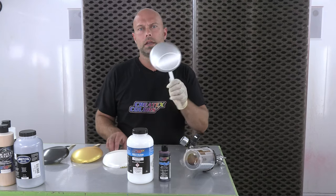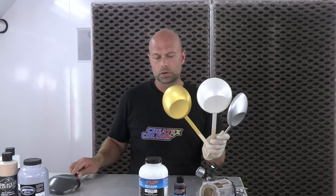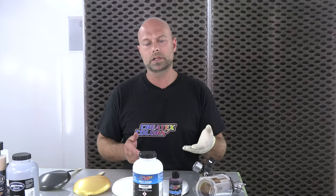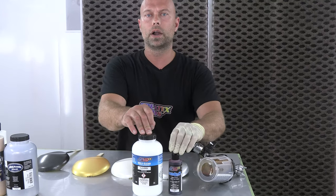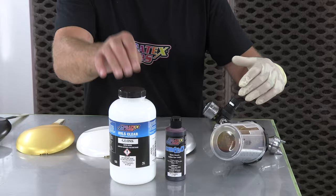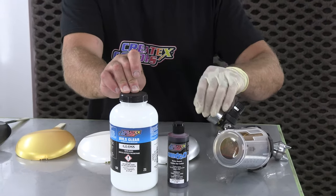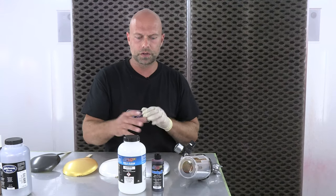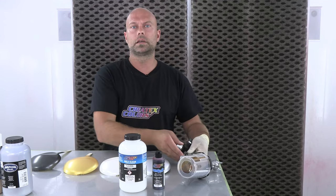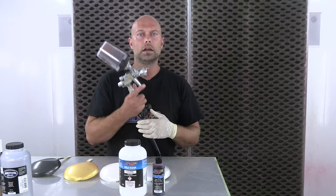Our base coats are all totally dry — we have our silver sealer, our coarse metallic white, metallic gold, and our charcoal metallic — and we are ready to start spraying some candy. For the candy I'm actually going to use red oxide. I have my 4050 right here, and this is a good indicator of the ratio: 6 to 1 is what I recommend for a spray gun — anything with a large spray gun, 6 to 1. When I mix this together it's right at that target viscosity; I didn't have to add reducer. If you do add reducer, 5–10% maximum. This is my Iwata Supernova Evo with a 1.2 tip — technically a clear coat gun, but it works extremely well for our candies.